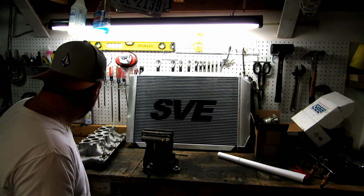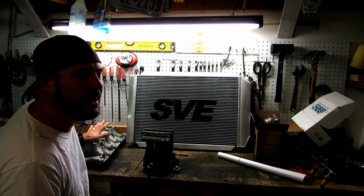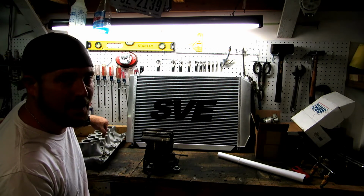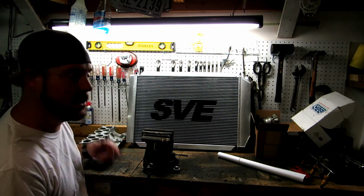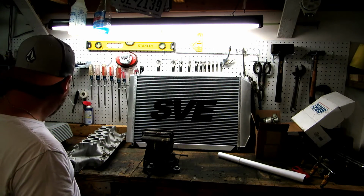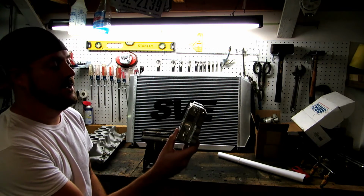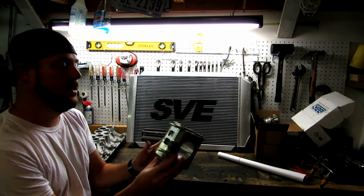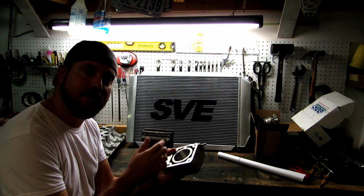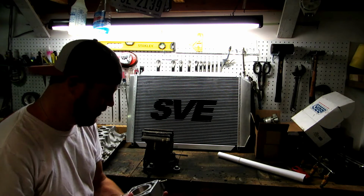And when I took this up to them, they quoted me $100 an hour. He said it'd take over 2 hours. It basically is going to be over 200 bucks to drill and tap the bosses in this and mill out my EGR spacer. So I got this back from the shop. I'll show you guys this. I got my 65mm EGR spacer now bored to a 70mm to match everything else up. And we're going to hopefully line this up. I just got this back, so I haven't actually put this up to the intake manifold, but we're going to make sure that this lines up, make sure that he milled it correctly, and yeah, let's get going.